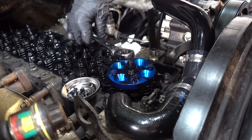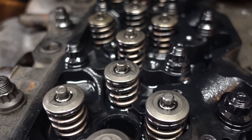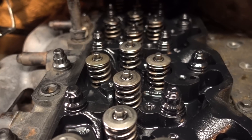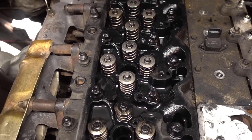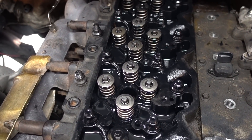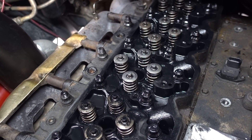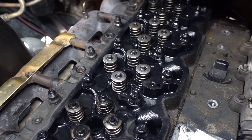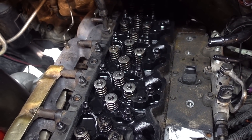Quite a bit later and we do have the valve springs completely wrapped up. After the valve springs are all done, we can start assembling: putting the injectors back in, getting those torqued to spec, getting the crossover tubes back in torqued to spec. The complete sequence is pretty easy to look up online — basically seat the injector, seat the tube, final torque each one in a specific order and specific torque. That is definitely very important. From here on out we're just going to keep everything super clean.